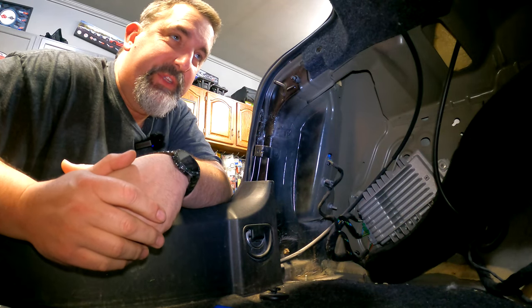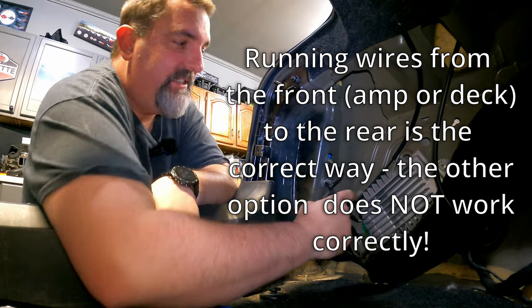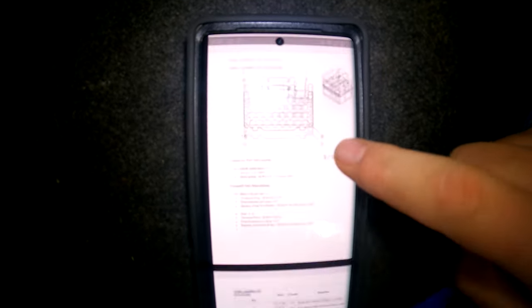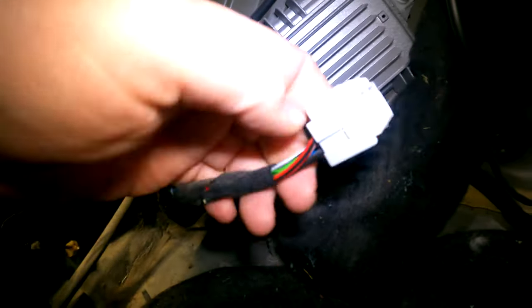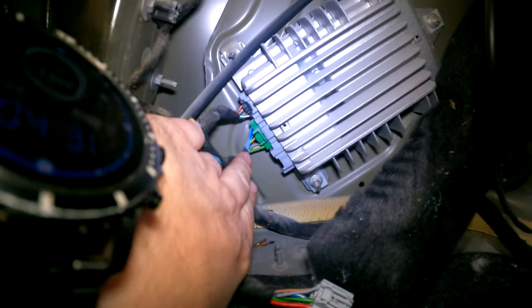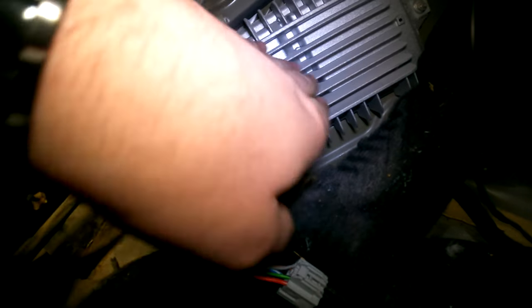Now there are a couple different ways we could do this. What we could do is run speaker wire from the back of the head unit all the way back here and just splice into the wires that come from this amplifier and go to the door. I'm using a diagram I found online that tells me which wires on the harnesses on this amp are what — I'll put a link in the description where you can download this. I'm going to unplug all of these because each one has a different wire I'm going to use, with wires going out to the speaker. I'm going to cut the wire coming out of the amp and splice the left channel speakers together before they ever go through the amp, so that way the power coming from the back of the deck or the amplifier I'm installing is going to use the factory wire.